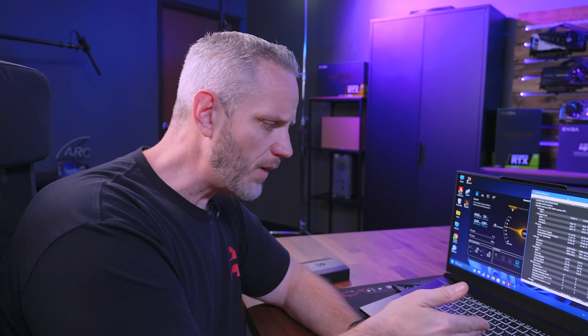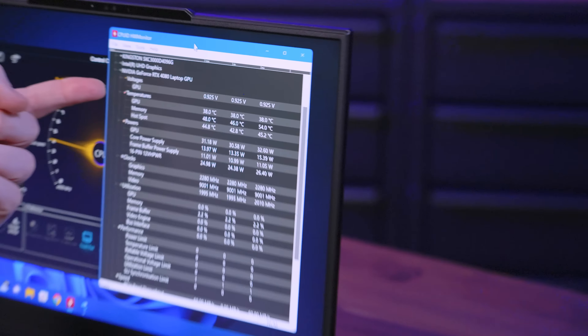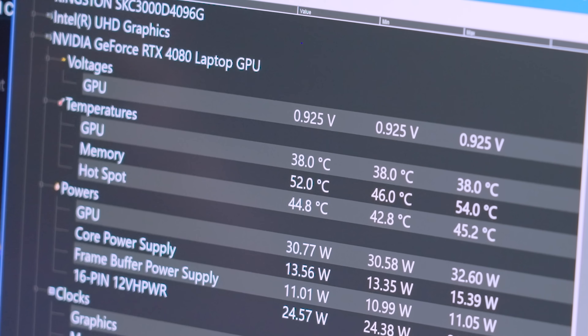The reason I'm also checking this is perfect timing with that email — while we were at LTX, I let my daughter play on this PC. I asked her how it was performing and she said it was good but there was some stuttering, hiccups, and pausing. So I thought maybe I should check those temps. With the free version of Hardware Monitor, you can see memory temp, hotspot temp, and all that. Ironically on the pro trial you can't — pro tip, just get the free one. You can see everything you need and it doesn't expire.